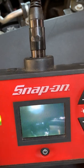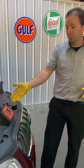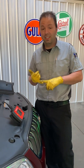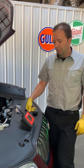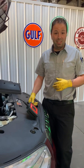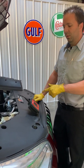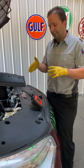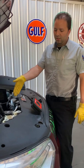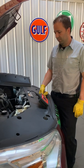Look at the backside of this intake valve — super clean, way cleaner than it was. But this vehicle has 49,000 miles and this is the first GDI service that's ever been performed. This is exactly a prime reason why we recommend every 15 to 30,000 mile service — to prevent it from getting to this point. I think one more cleaning on this vehicle will get it to a hundred percent, or even just a little more road time — maybe another 500 miles. This is why we recommend GDI induction services every 15 to 30,000 miles to keep preventative maintenance as easy and efficient as possible.